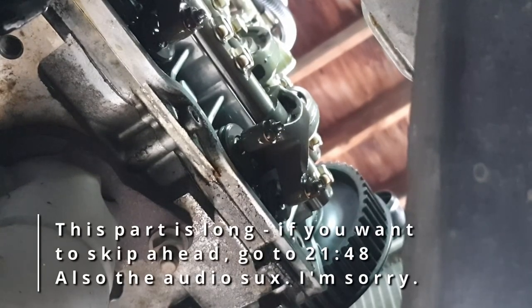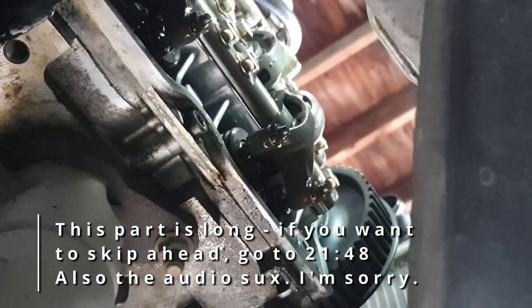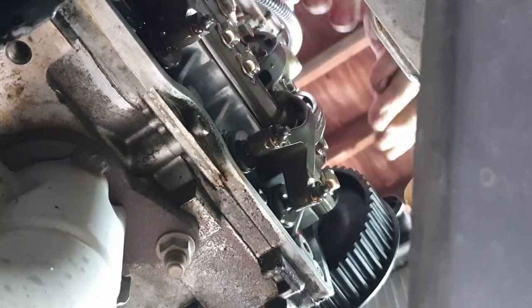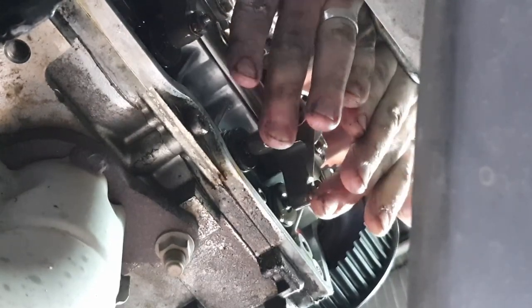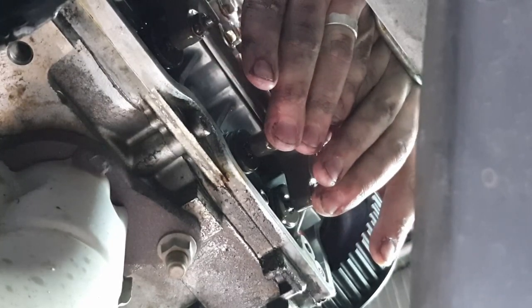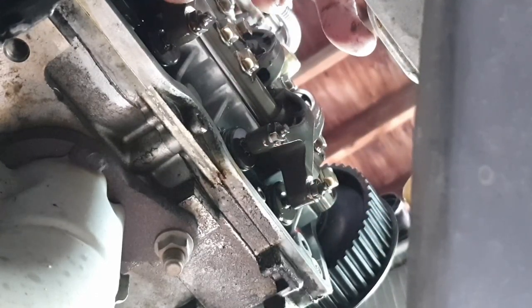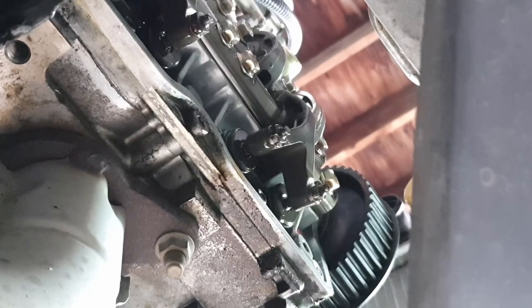I'm going to try to adjust these exhaust valves on camera. This is the passenger side, so right-hand side, of this EJ22 1989 single overhead cam motor. Right now, I don't have any play on those, which means that it's either depressing or letting up the valves, the exhaust valves in this case. This one does move. So I want to get both of them to the point where they're wiggling, and I can hear that sort of lash there.